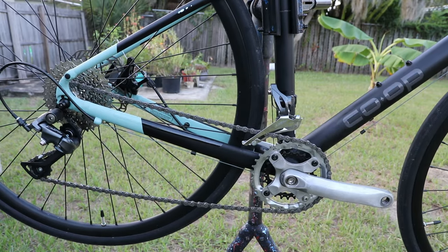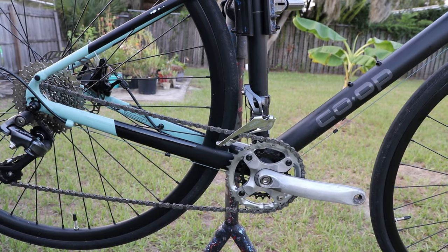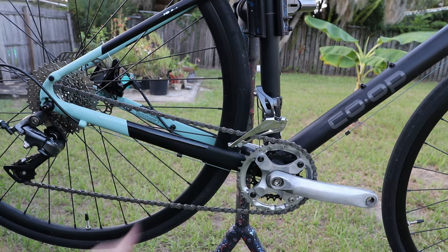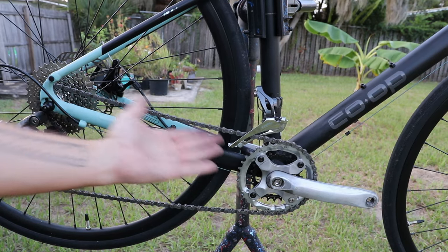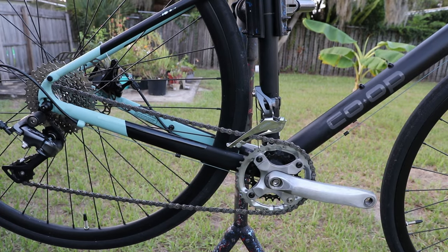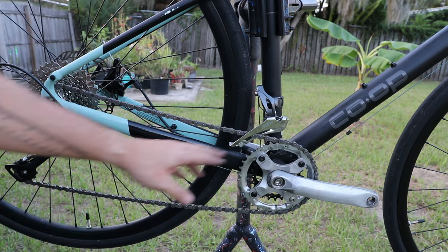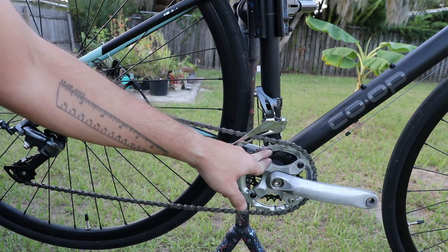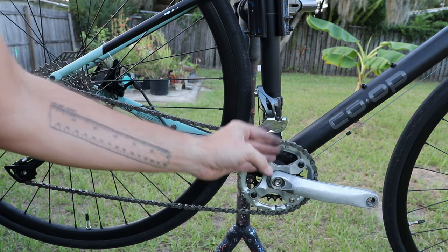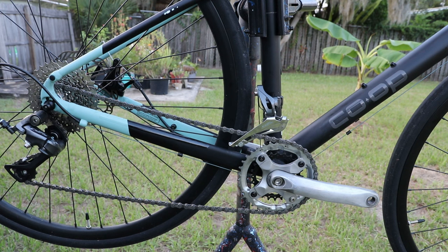I'm going to put the pedals on and give it a ride to see if it's actually any good. I think that'll work just fine. What I wanted to show is that rather than putting a giant cassette in the back, you can actually change the chain ring in the front to get better climbing gears, and it'll save you maybe 250 grams — that's pretty nice. Be careful about water bottle mounts, because that's not ideal. I'll leave in the comments whether this ends up working long term or not, if I start having a lot of chain drops. Maybe going up to a 38 or 40 chain ring will help with retention. Let me know in the comments what you think! Thanks everybody for watching — I'll see you guys in the next one.